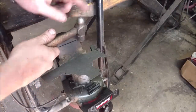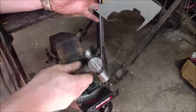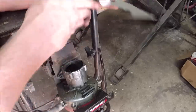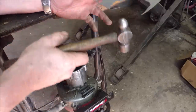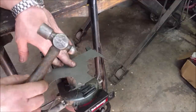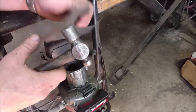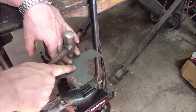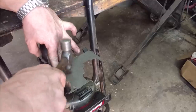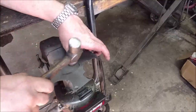I'm just going to take this piece of gasket material that fits over this hole, and our tool is just a ball peen hammer - you need the ball to actually be able to do this. A lot of people in my first video were concerned you're gonna shatter the housing, but this is pot metal, probably a zinc-aluminum blend - just junk. You can see the piston rod is just a piece of stamped steel, nothing high-end. It's not going to shatter. So we lay the material out where it's going to cover, and I'm hitting on the side to use this natural cut edge. You kind of feel it, and you're not hitting hard.